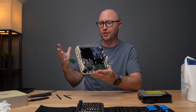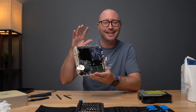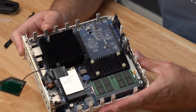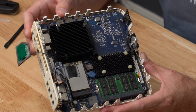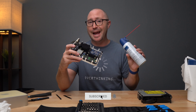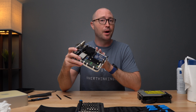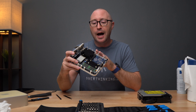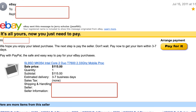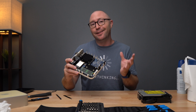I'm actually shocked - really shocked - about how clean this thing actually is. This thing was used in a household environment for 10 years and then sitting in a dusty, hot, gross garage for another 4 years. And look at this thing - it's almost like it hasn't been sitting around for 14 years. I think all I'm really going to do is spray these things out with some canned air and call it good. One of the reasons I did want to open this up is because I did some upgrades back in 2011. I upgraded the processor from the original 1.5GHz Core Solo to a T7600, which is a 2.33 gigahertz Core 2 Duo, so this thing actually got a little bit better lifespan.